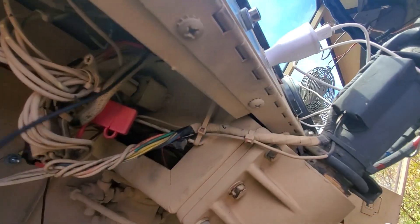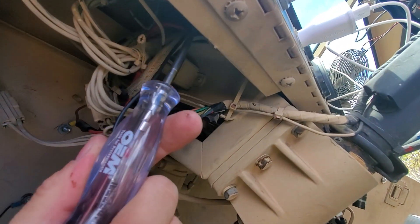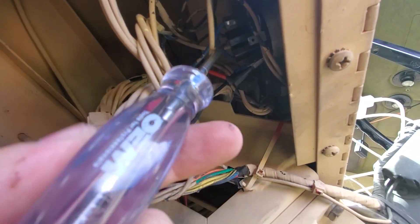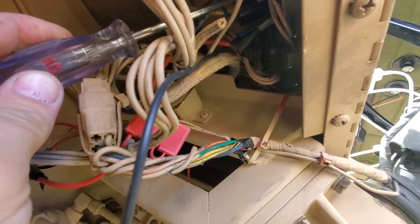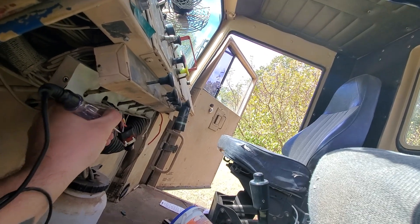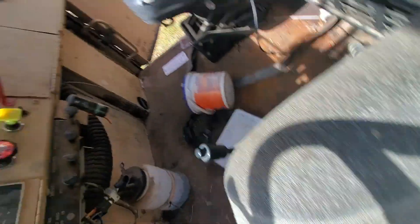Let me redo my ground here. This is actually the accessory wire that goes out under the cab right into the hood area. That's a ground, and that's accessory power right there — the power goes outside. All these wires here showed power coming out of them. I didn't find any loose wires but they're all showing good. Over here at the switch though, we have no power into it.